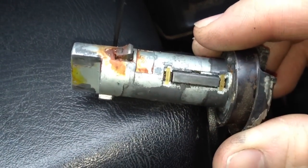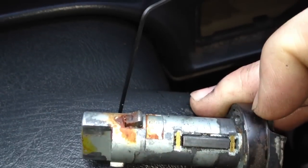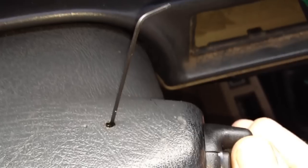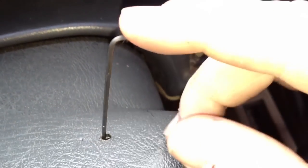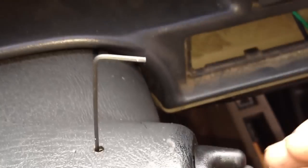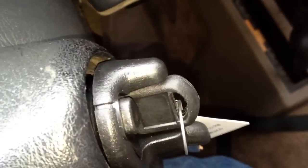As you can see, this goes in just like that. This pushes in. All you do with that allen wrench is push down in. You've got to turn this all the way to the start position, so please disconnect your negative battery terminal. You turn this to the start, and at the same time you push down on this allen wrench. You can use anything that you have. Push down, you'll feel this release. You pull straight out on the lock cylinder — they come out just like that. For your new one, all you do is push it right in, just line it up.